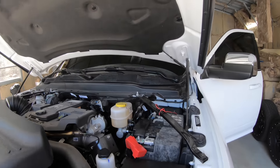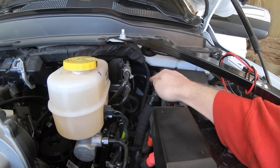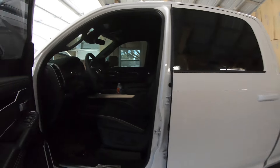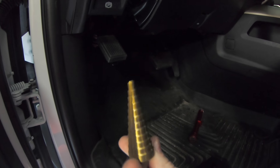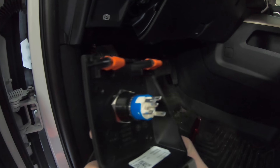Now to the wiring stage. We're going through the cab. You see that plastic piece — the little oval shape — that's what we're drilling through. Drill through that and you can run some wires through; it comes through your firewall. Then right next to your parking brake, you have this panel that pops right down. If you have a RAM box, this is where your RAM box switch is. I drilled a three-quarter inch hole through it using one of these bits — goes right through. Simple as that.